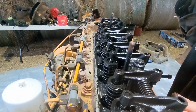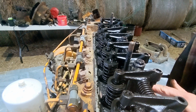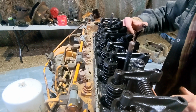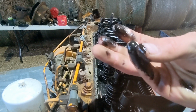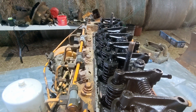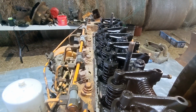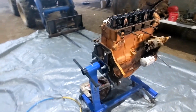But pretty nasty. I don't smell any fuel in the oil up here. That's good, and I don't think I see any signs of water. Okay, yeah, now that kind of metallic looking stuff, that's fine bearing material, I think, is what we're looking at there. So not good. All right, well, I'm going to put that cover back on, just sitting on here for tonight. But we'll be back to finish up building a containment around here.